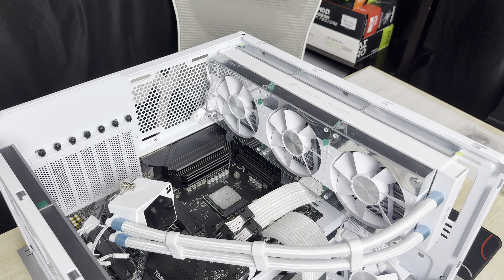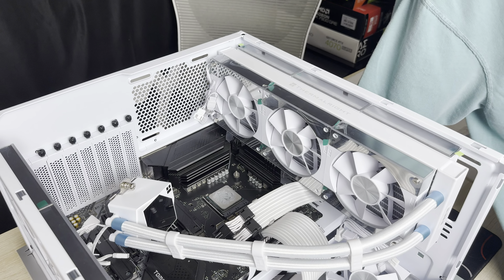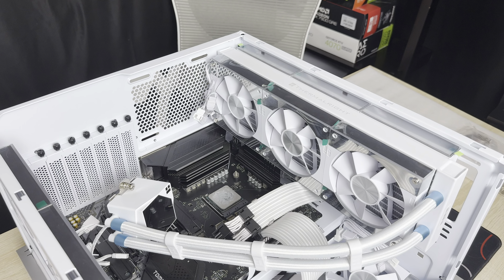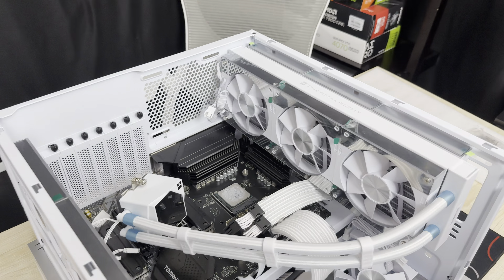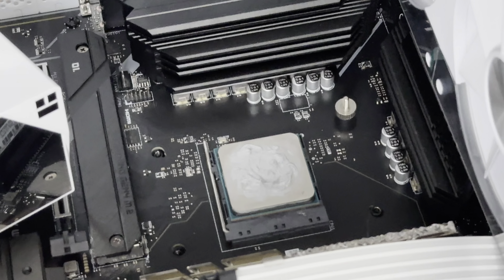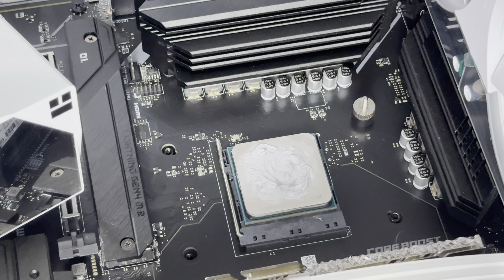Take finger, make it pretty smooth and let's see how even we can get a spread. This thermal paste just doesn't spread very well — it's so goopy, it's like it's already dried out. Usually I go for a nice even spread everywhere but we're not going to be able to do this with this thermal paste. No spread tool really works for it — I should have just gone with a P-dot method. But that's fine, it's good enough. I think that is plenty of thermal paste.